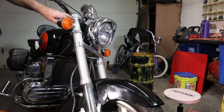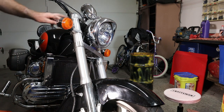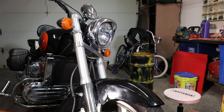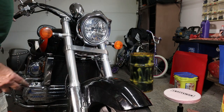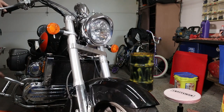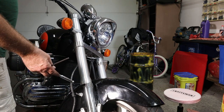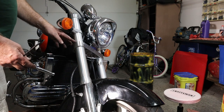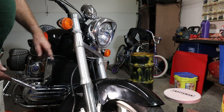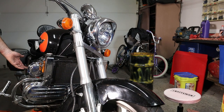Now, we still have the windshield mounts and the wind deflector mount to put on. I won't bore you with that. But that's essentially rebuilding a fork on a Honda Valkyrie. Things to know is this side does not have the damping rod in it. It's actually easier to do. So we did the hard fork, and it was the one that's leaking. Typically, it's the one that leaks. And then we got this tightened up. We got to torque these down yet, put our windshield mounts back on. And this is pretty much a done deal at that point. So thanks for watching.